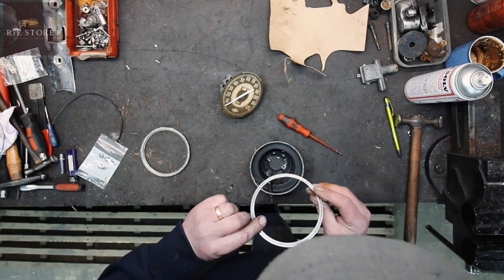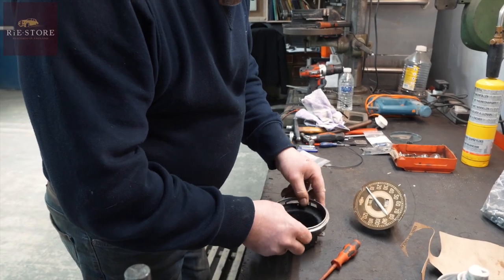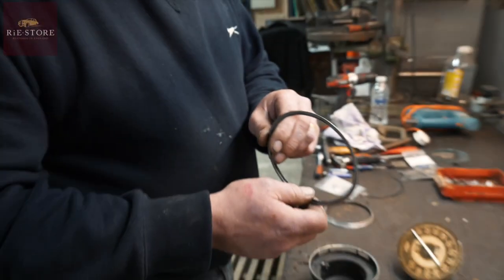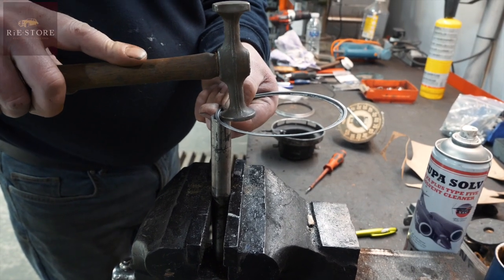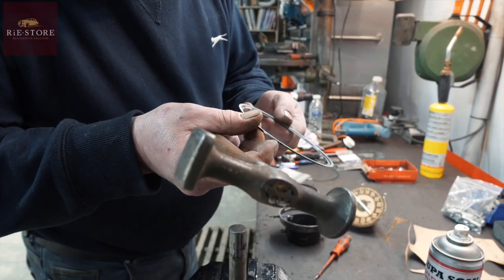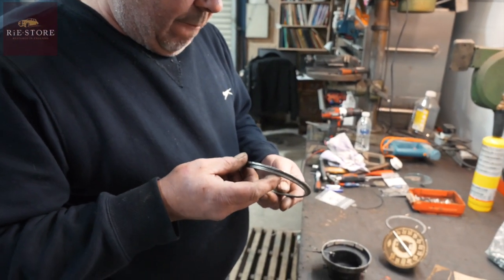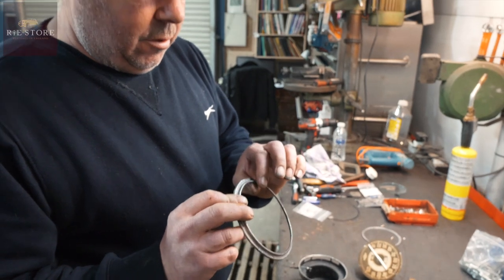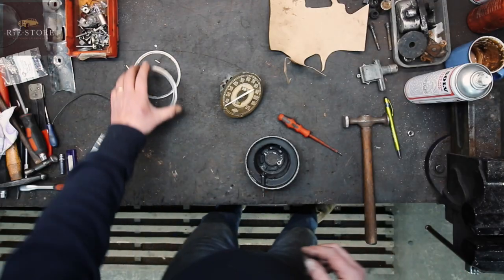The first thing to do - you can't see any of that when it's in there, so that's not an issue. Just go round and check anything - like you see that little lip there? That will hold that face off and make it harder to roll round afterwards. So just check it for any nasty lips and bumps. Unless they're completely and utterly knackered, you can normally get them back on. The minute you try and straighten these, you're in a losing battle, because they'll just kink and go funny. You're better off leaving them as they are and just trying to use them as they are.